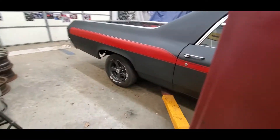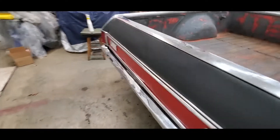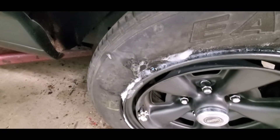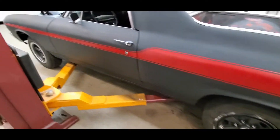Okay, we're back on the ground. He was soaping these tires up looking for air leaks, and the bead on this one leaks — you can see it. He's got to reseal that one. Not the end of the world.